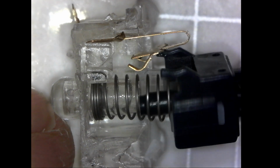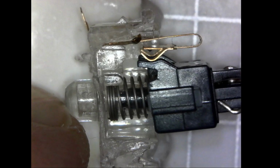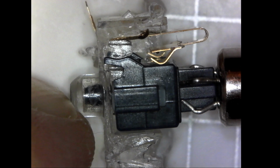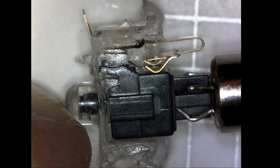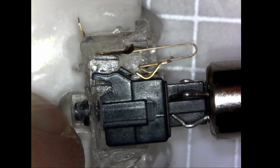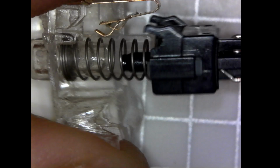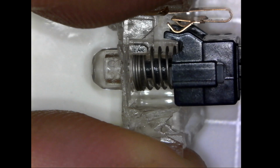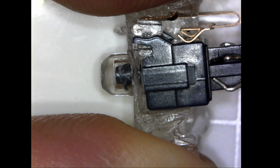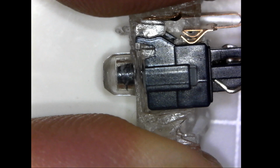When the switch bottoms out, let's get it lined up here. At some angles, the first thing to bottom out is actually the leg. You can probably see right there the leg. The leg of the switch can touch the stem. Now, of course, the leg is not dampened. It's just plastic, so when that leg touches the housing, it's going to make a noise. It's going to make that tapping noise that you sometimes hear with these type of switches.